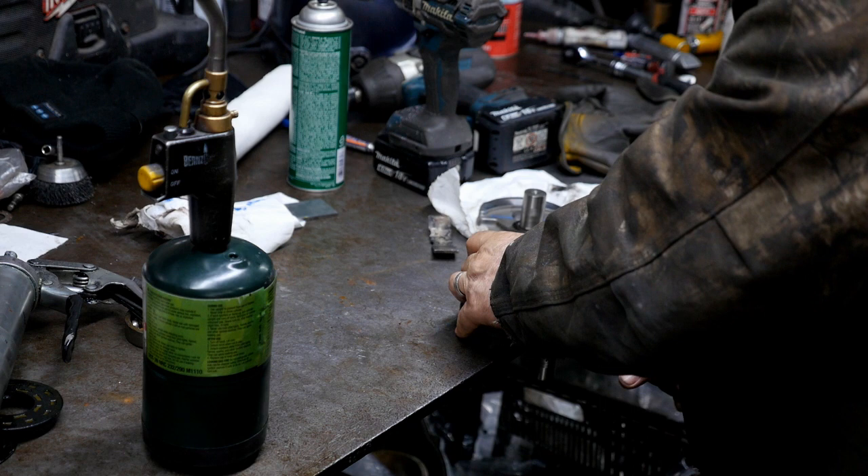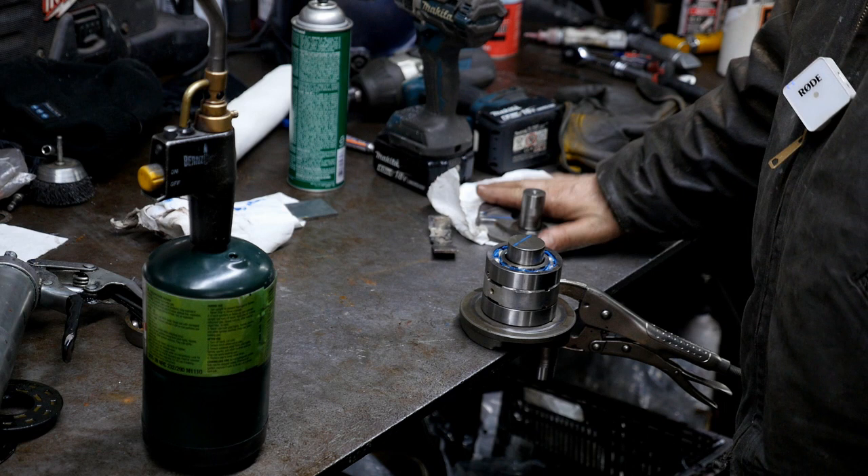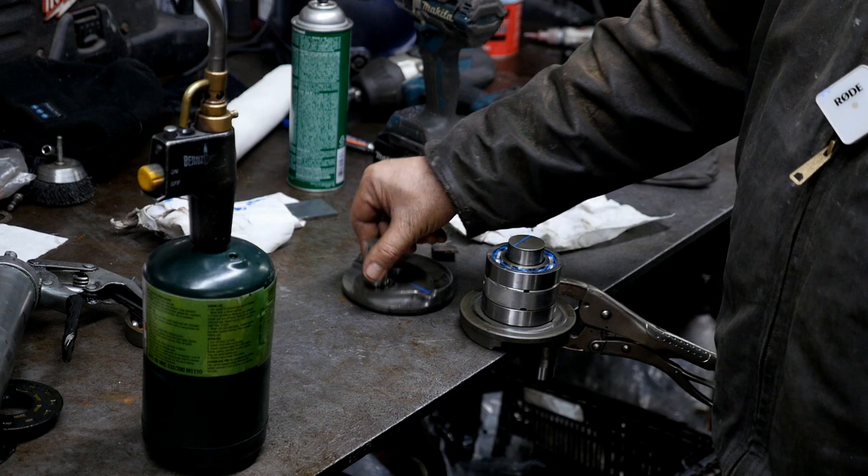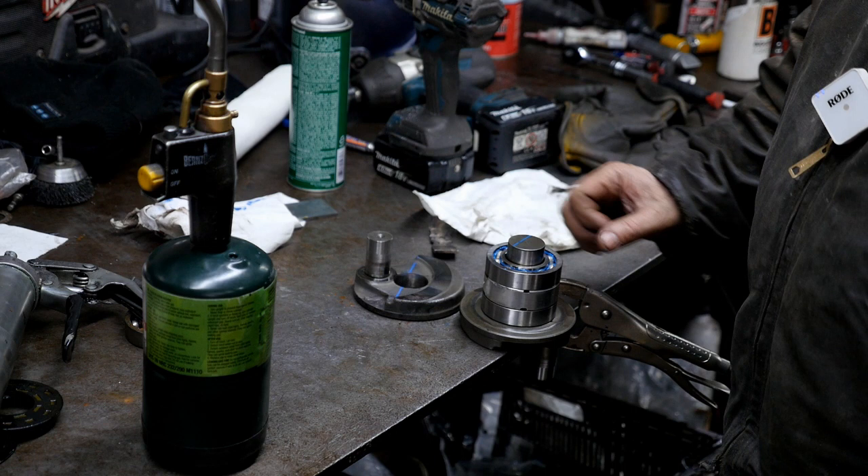This is a little hot, so I'm going to wait a few minutes for this to cool down. I want this pin cool because when it's hot it expands several thousandths, which can make this go on too tight. Obviously I don't want it on tight because if I have to move it a tiny bit I can, and after I'm done I'll go ahead and weld it like the other side. Let's clean up our rods while we're waiting.